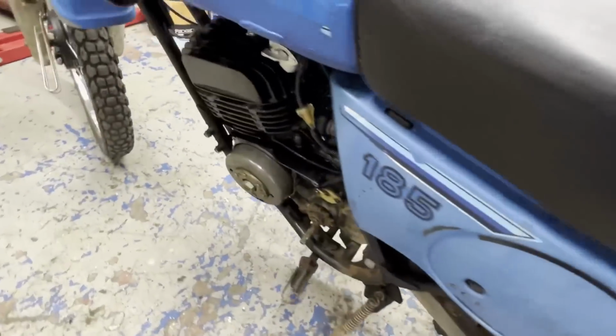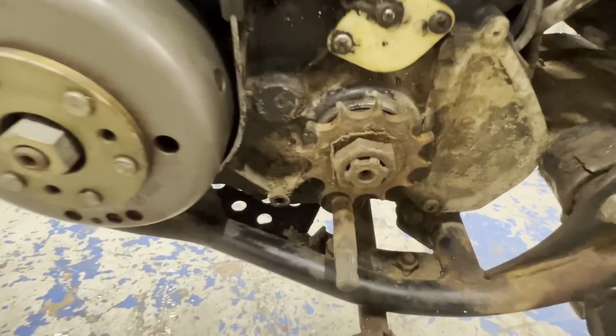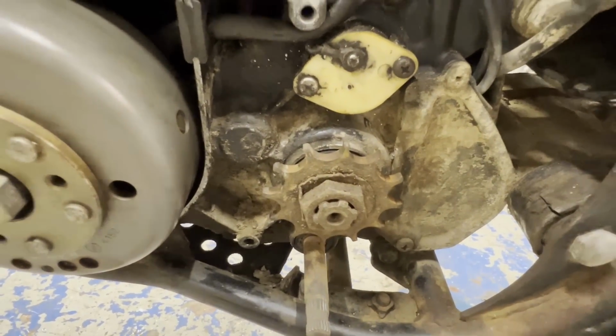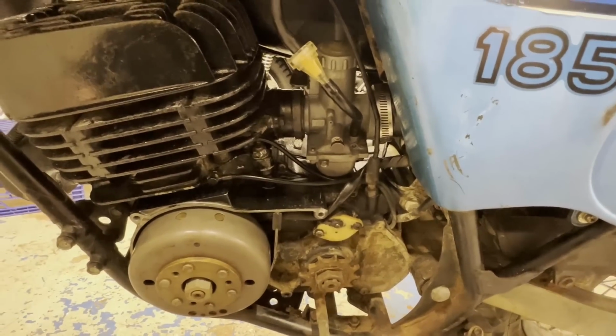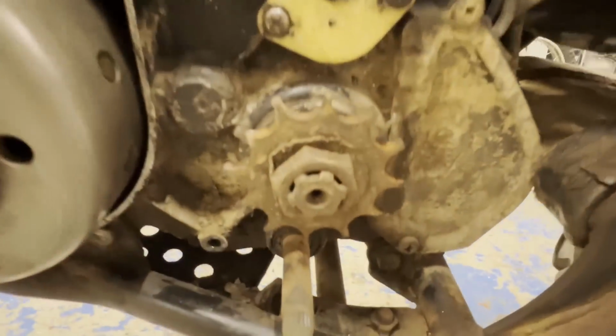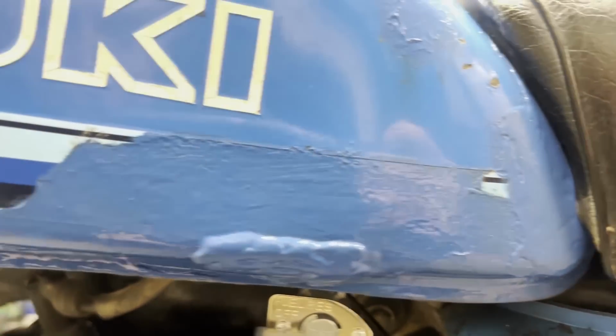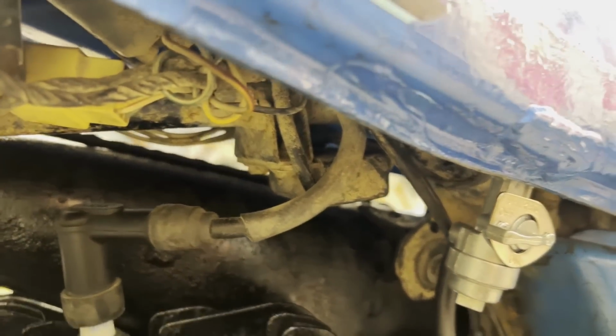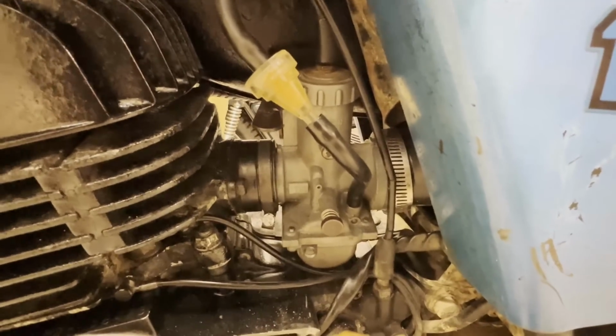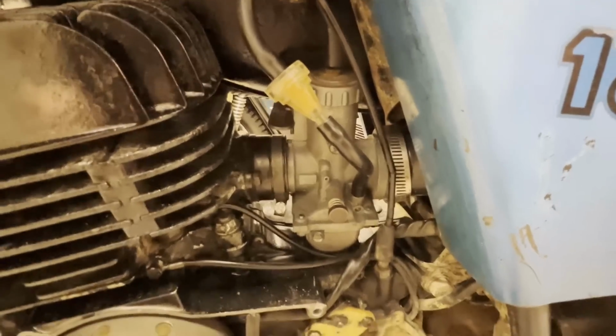So in the next video I should be riding it around. The other thing is this sprocket never came in for me to put the chain and sprockets on, so I didn't want to put a new chain on that. So, another plus is the fuel tank is actually holding fuel. It's not leaking anywhere, so the patch job seems to be successful so far. So crossing my fingers, and hopefully that stays that way. Just double check that float and make sure the idle air circuit's cleaned out and everything else. Just going to go through it all again.